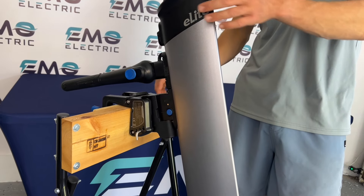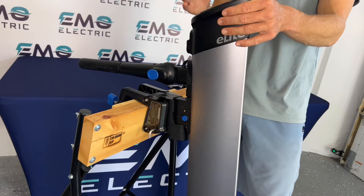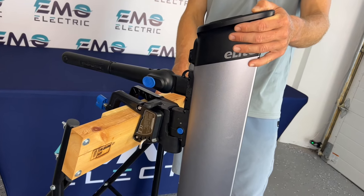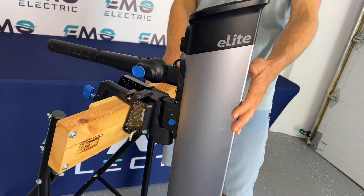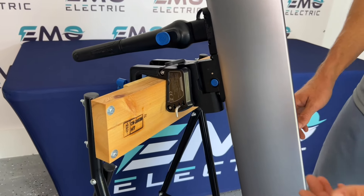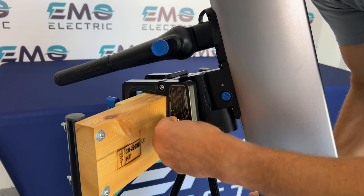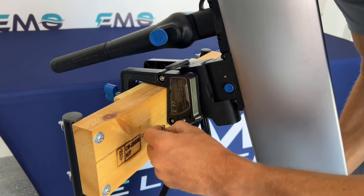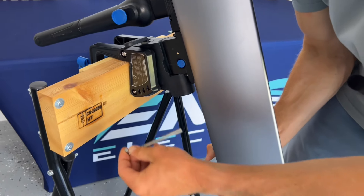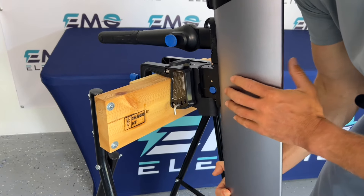You can see now it's angled because our motor mount is perpendicular. But if I tilt that back like an angled transom, the motor would now be perpendicular to the water. To take the trim pin out and put it in, you press it in and turn it up. You might have to lift your motor up a little bit to take the pressure off, and then you slide it in.